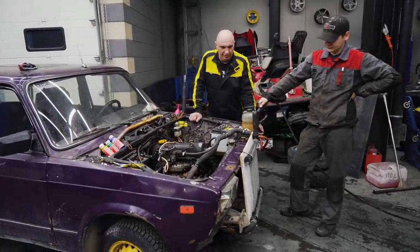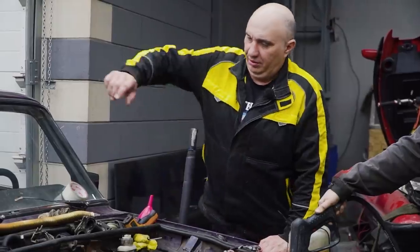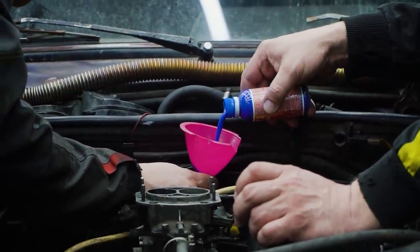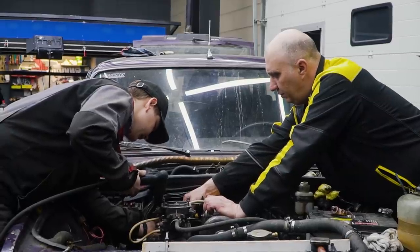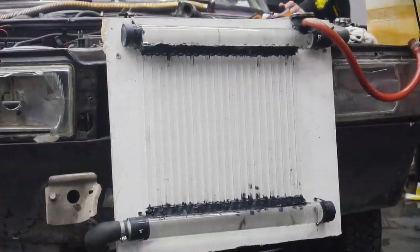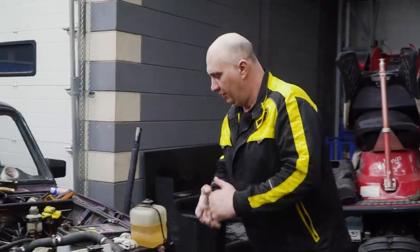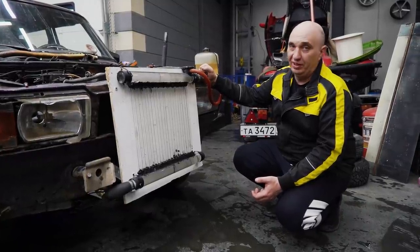Everything has cooled off. We are filling the system with cold water and leaving a bit of room to add some dye. I think we should start with this nifty blue colored one — we should see it very clearly. Pouring in the dye now. We'll pour all of it since there's not much anyway. That worked out beautifully — now it's full. Starting the engine. The liquid is currently going round the short circle. This will show us how much actually makes it past the valve, but until the engine warms up and the thermostat opens, we won't see any blue water on this end.